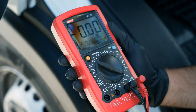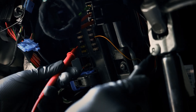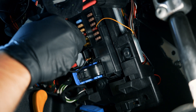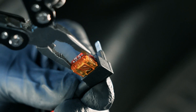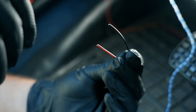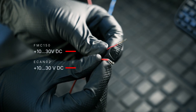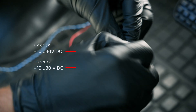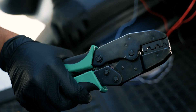Using a multimeter, find a slot in the fuse box with constant power to ensure uninterrupted device operation. Connect the negative probe to the vehicle frame, which serves as ground, and touch the positive probe to a circuit point reading around 12 volts with the ignition off. The fuse adapter must be installed securely and in the correct orientation to guarantee proper contact with the fuse terminals. Prepare the power and ground cables using a wire stripper. Connect the red power wires from both the ECAN-02 adapter and the FMC-150 tracker — they must be connected to a constant 12- or 24-volt power source, in this case to the fuse adapter we just installed. Secure the connection with a crimping tool.